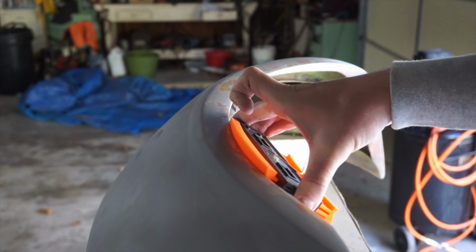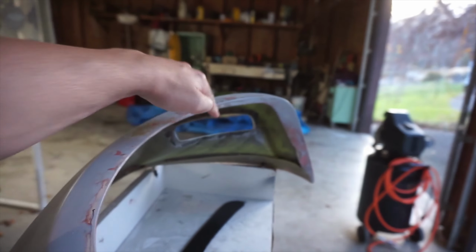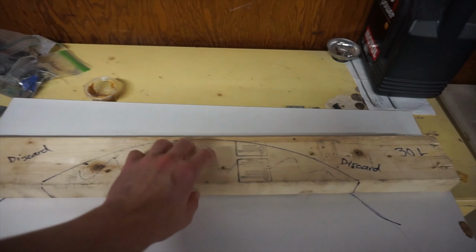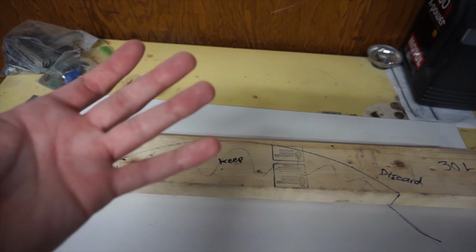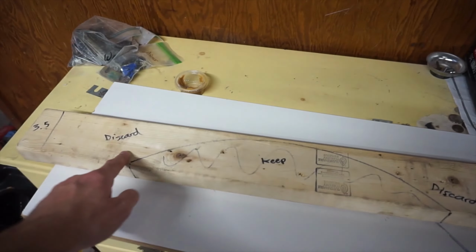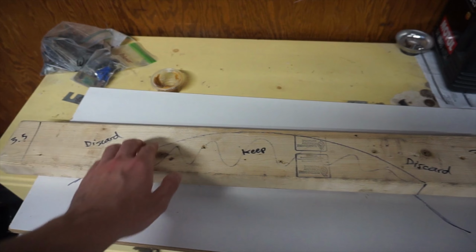The arches of all the fender flares took so much abuse from my random modifications and the unrestricted sanding that it felt impossible to get the sanding to yield a perfect curve and not be lumpy and uneven. So I brought this piece of wood to my friend Hunter's because he has a CNC machine, and that way we could cut this into a sanding block with a perfect 27-inch diameter, matching the fender flares, mostly.